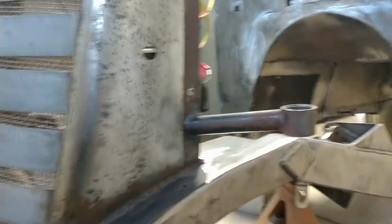And then when I'm sitting here looking at this again, I'm realizing that this would have been maybe something cool to use these fellas. What is really nice about these is that the 1930 headlight bucket fits in here perfectly. It just fits right down in there, and with this rounded, let's get the camera over there so you guys can see. With this little bevel in here, and on the bottom of that headlight bucket, it's rounded. So when it fits in there, I've got total adjustment, right to left, back, forward. It's just really cool when you find stuff that you have and you can utilize it for multiple things like motor mounts and then these headlight brackets.